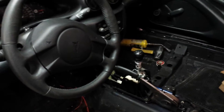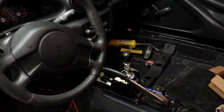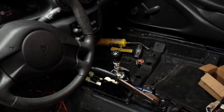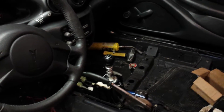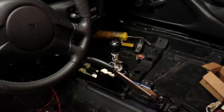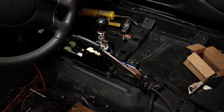Right there is the MS-3 Pro computer, which is going to be mounted behind the panel on my center console. I basically decided I want to keep as close to a factory look as possible, so I went with the Megasquirt and decided to use the factory PCM as a dongle or simulator to retain all the factory cluster, HVAC, and body control module functions — such as interior lighting, anti-theft, and all that.